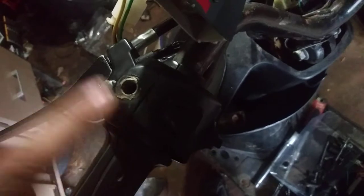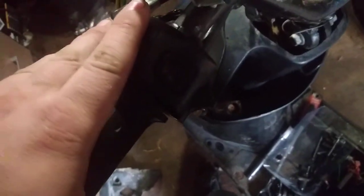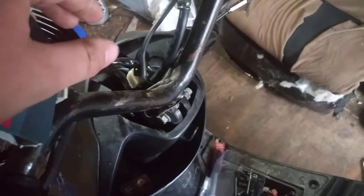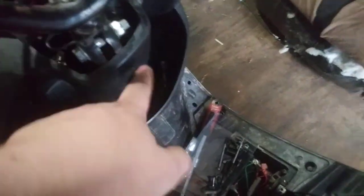The yellow wire that was in here for the headlight switch is gonna be the black wire on this new switch. The red and black wires match to the two gray ones for the horn. There are three gray ones total — one is for the blinker and the other two are for the horn. I wired my high and low beams both into the same one so the light will never shut off. I also removed the blinker, which I think would be really cool to add back. I've also got a little mirror radio system — I'll show you guys how to install that; I'd be more than willing to do a video on it.